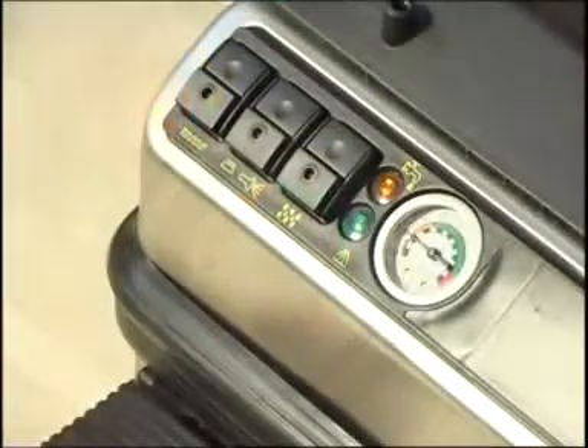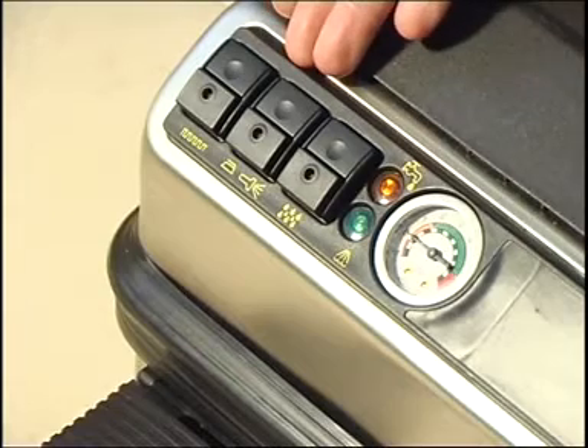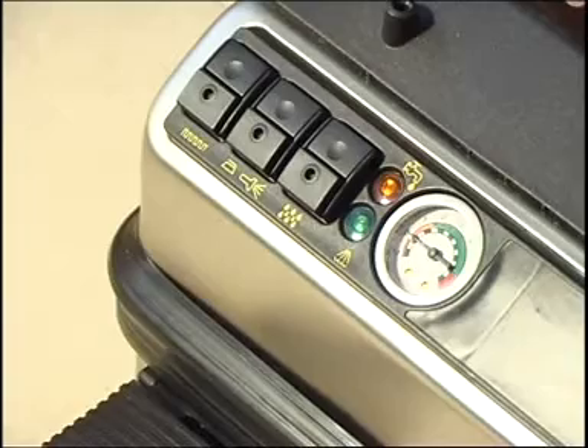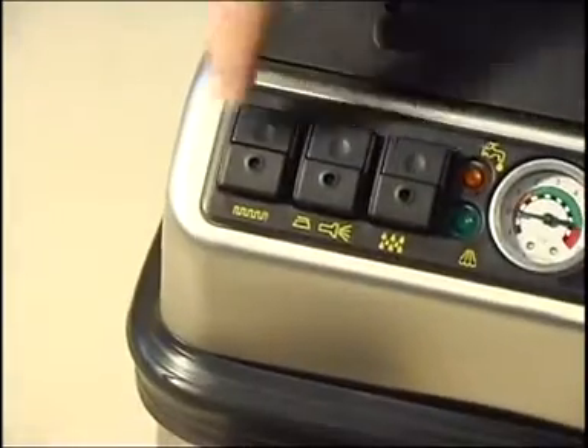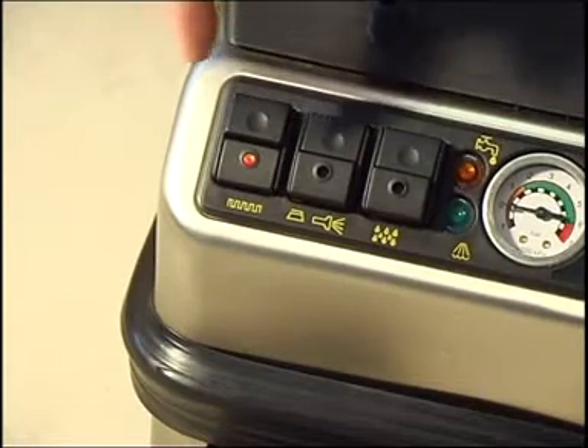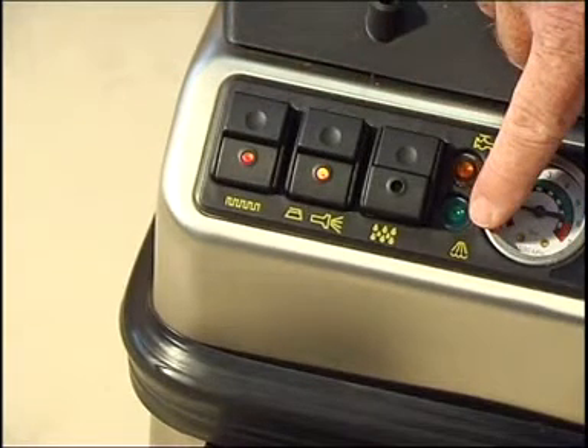On the left of the upper front fascia you will see three on/off switches. The first button on the far left is the main power switch, which you turn on by pressing the lower half of the switch — the lead light should now be on and you are now heating the boiler. The green steam light will illuminate when the boiler is at the correct temperature and pressure to give you optimum cleaning power. This light will go on and off as you use the appliance, indicating the boiler is maintaining heat and pressure, which is normal.